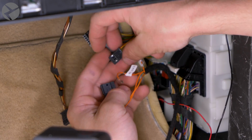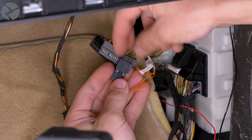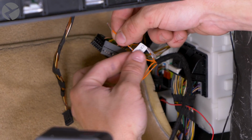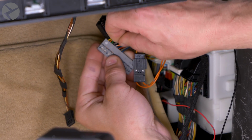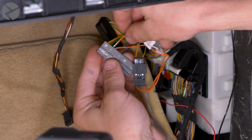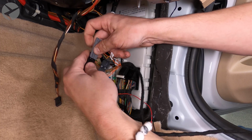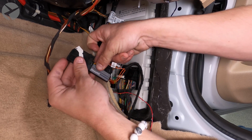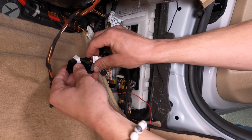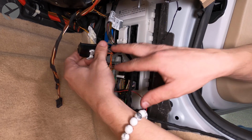Plug the connected pins into the Beamer Tech harness and finish up with this section by taking the non-connected solid orange cable and snapping that into the pin 50 slot on the BMW connector. Slide the 2 halves of the connector together. To rebuild the connector, line up the tabs on the connector sleeve with the tracks in the pin retainers and slide the 2 together until they click.